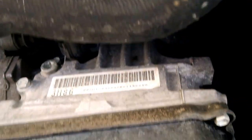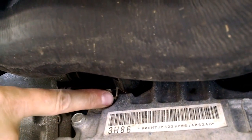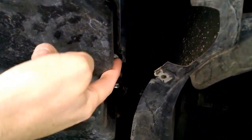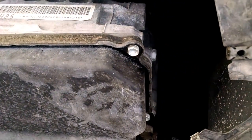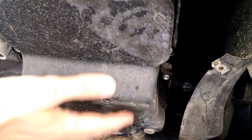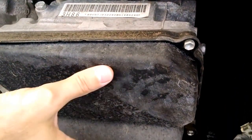Once we've cleaned the pan and put it back together with the gasket, we'll fill it using the pump and hose through the fill plug opening. The first thing I'll do is loosen the drain plug and let it drain. Once it's done draining, I'll remove the bolts that go around the pan — loosening them all the way around first, then removing them. I'll let the back of the pan hang a little lower than the front in case more fluid needs to come out, then drop it all into the drain pan.